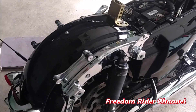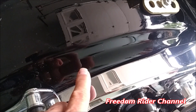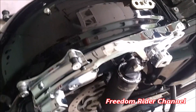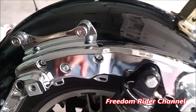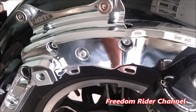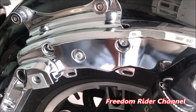You really ought to check out what's underneath your seat and so forth. I had a spot right here on the fender that I was unaware of that was almost to the point of rust. I buffed that out with some buffing compound and put a good coat of wax on it. I also had rust developing on the four-point docking system in this area and underneath here.